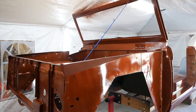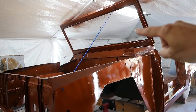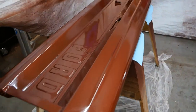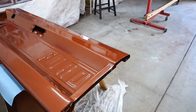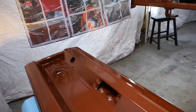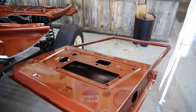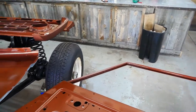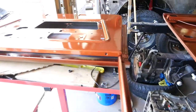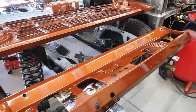The front of the car including the broken fishing rod extender that holds the windshield frame up so I could paint everything without it touching or falling and hitting the front clip. The tailgate turned out really good — three coats of clear. I'm going to do all the outside panels in three coats. There's one door — a little bit of orange peel but not too bad. I did the underside of each fender and the underside of the hood.